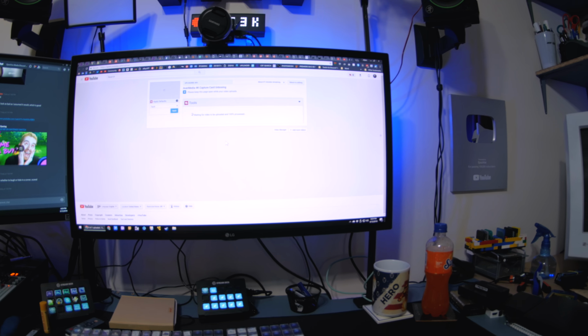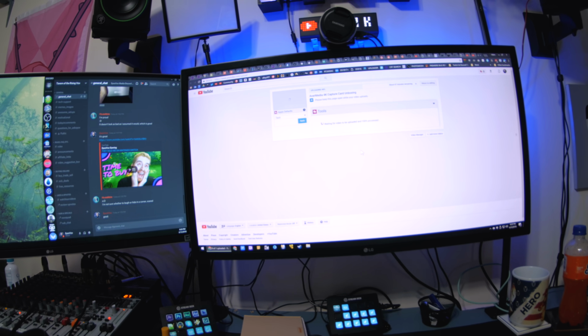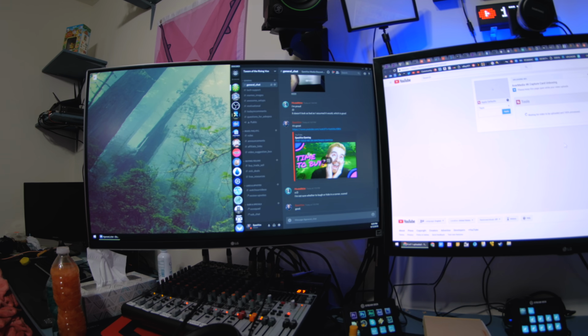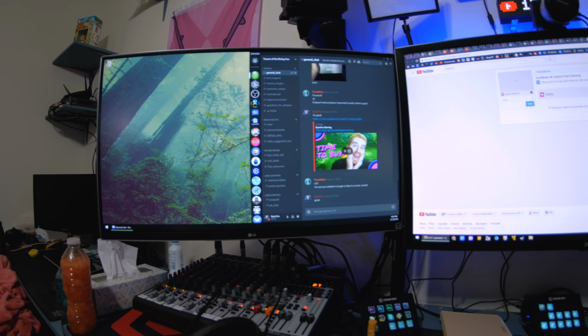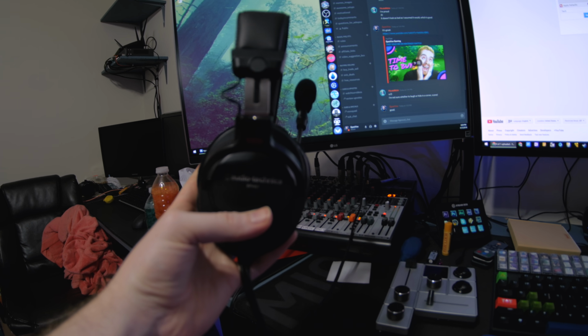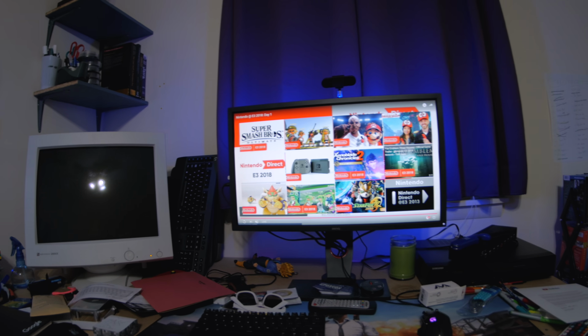To get around this, I've been using the obvious solution in front of my face. Literally. Most computer monitors have a headphone output jack. So I simply routed one of my monitor's headphone output jacks to a mixer input, and that serves as the output device for my VoIP calls from Discord and Skype. That way I have a separate volume fader on the mixer for me, a separate device to map in OBS Studio, and I don't need a second sound card. Just about everyone can do this.